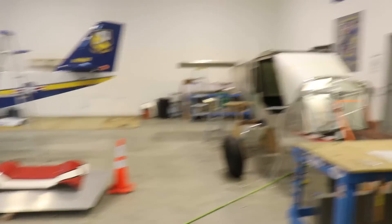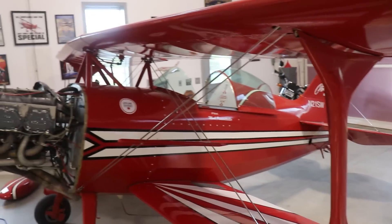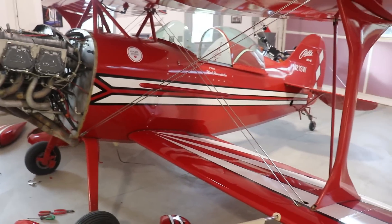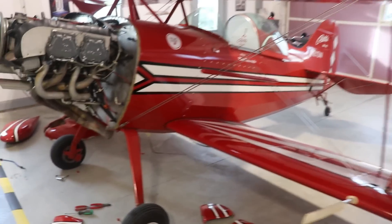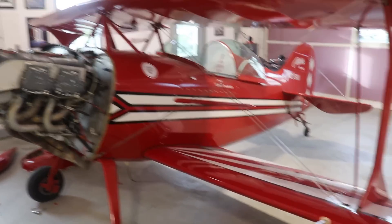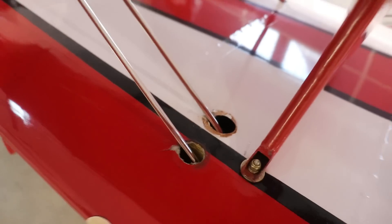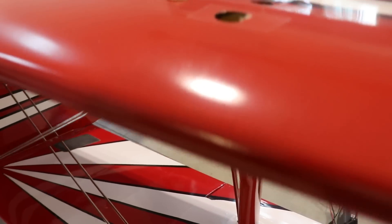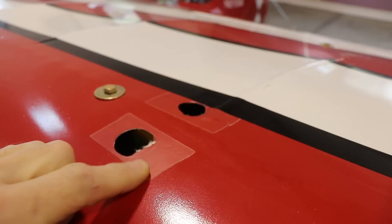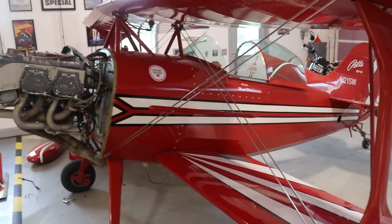My goal for this airplane is a full-on restoration, and this is going to be my project after the Super Duty is done. I'm going to cut all the fabric off, take all of the aluminum panels, strip all the paint off, take the airframe down and have it either sandblasted or stripped, repaint everything, recover it, and paint it — a full 100% restoration. All of the brake lines will get replaced, all of the fuel and oil lines, just everything will be brand new. A lot of the hardware I'd like to replace too, and I'd like to make nice aluminum covers for those big ugly holes where the flying wires go through. Same with the top wing — there's just a big hole there, and you can see when they built the airplane they just put tape over it. That's okay for now because I do plan on restoring this airplane.